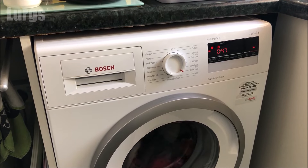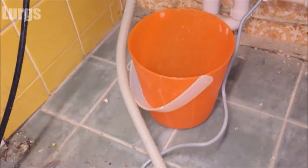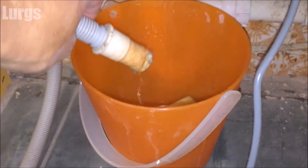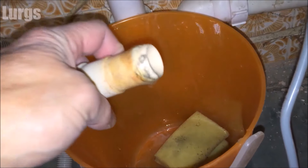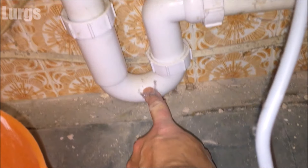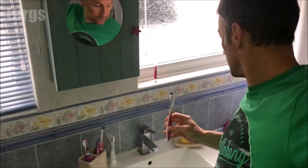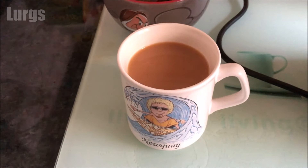Now you can try another wash. But if you've still got a smelly washing machine after all those steps, it could be a blockage in your drainage hose. Pull out your washing machine gently so you've got access to the drainage hose, take it out from the u-bend pipework, and check there's no gunk coming out of the washing machine — if there is, give it a good clean. If that's looking clear, check the drainage u-bend pipe. The easiest way without taking it off the wall is to put your iPhone on video with the flash on and just video down the tube — you should see lots of fresh water, which means no blockages. If it looks filthy with gunk in there, take it off the wall and clean it out. And don't forget to put your partner's toothbrush back and hope they don't notice — then it's time for a lovely cup of tea!